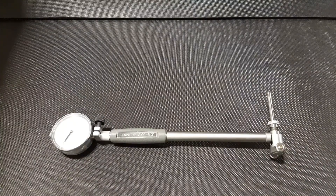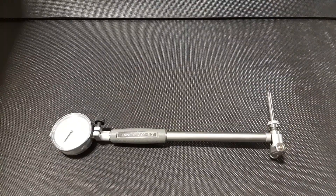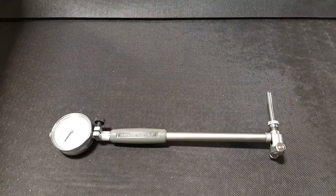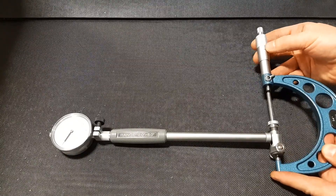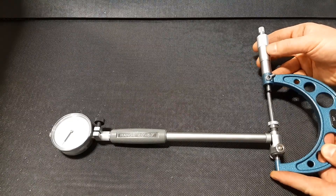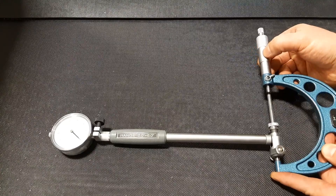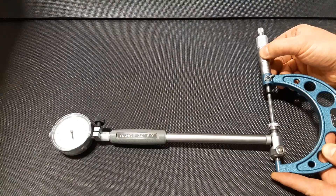I've turned my dial indicator 90 degrees so that the bore gauge will lay flat, which makes the next step a little bit easier. After I did that I reset my zero at my point of maximum wear — top of ring travel, 90 degrees to the crank center line. To find out the actual bore measurement, I'm simply going to take an outside micrometer to the bore gauge and use the mic almost like a clamp to squeeze the bore gauge and turn the indicator back to zero. This is why it's very important to make sure that when setting up the bore gauge it doesn't go more than 360 degrees — if it does we have to keep track of how many turns, which makes this step more complicated.